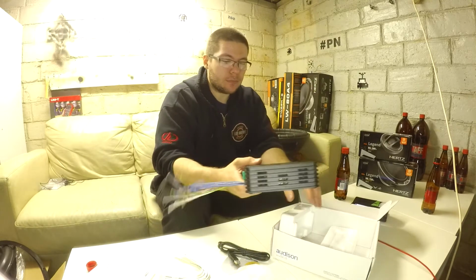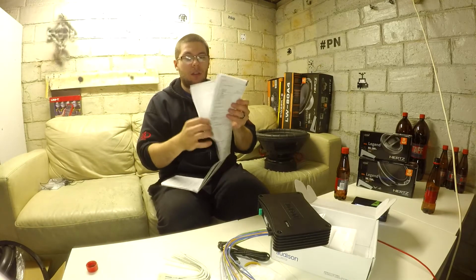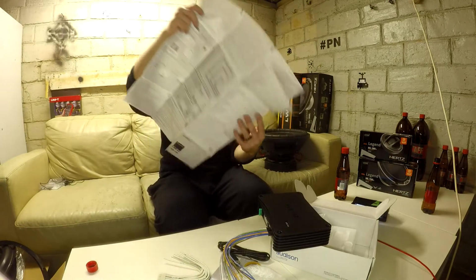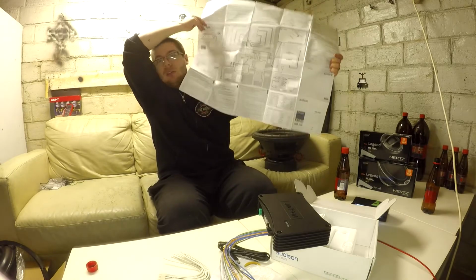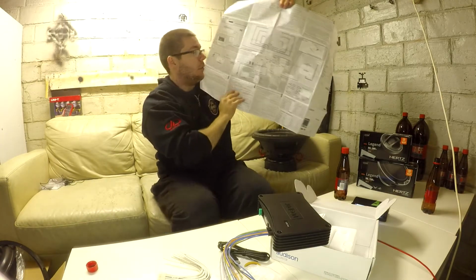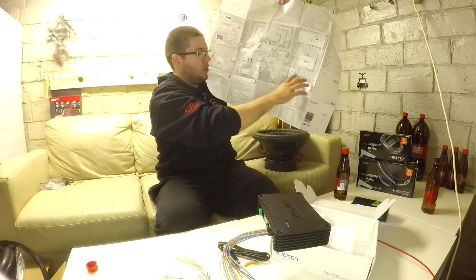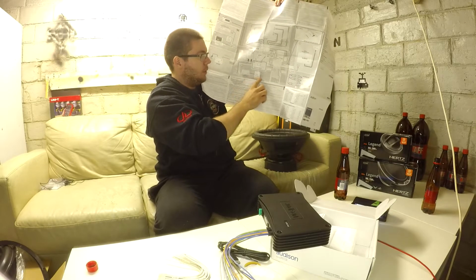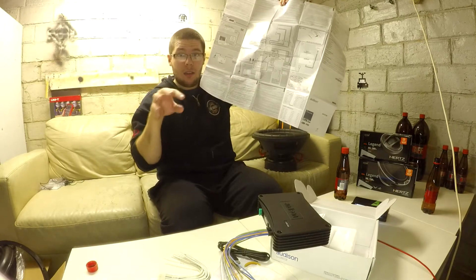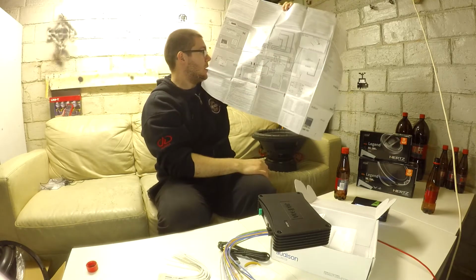So all the possibilities can be seen here in this manual. Now this is a quite small manual, with so many different languages, but you can actually see here what this is capable of. You can have an optional aftermarket head unit with RCA cables with an optional kit, or you can have an OEM sourced amplifier. Just put the amplifier's high level speaker wires hooked inside here to get the signal inside.